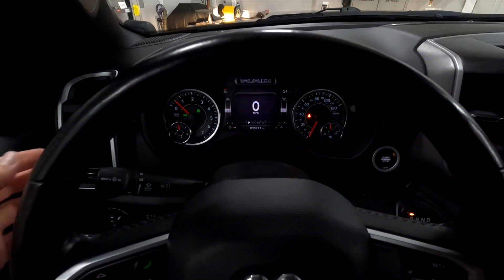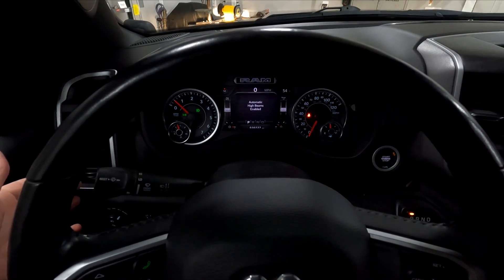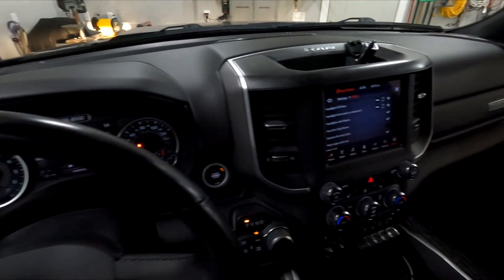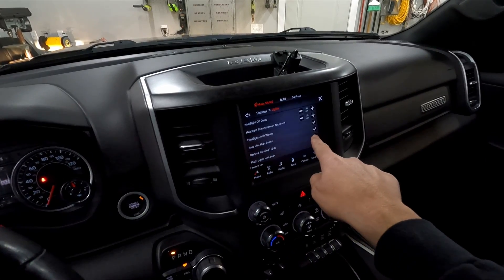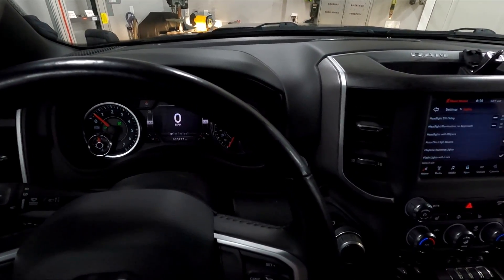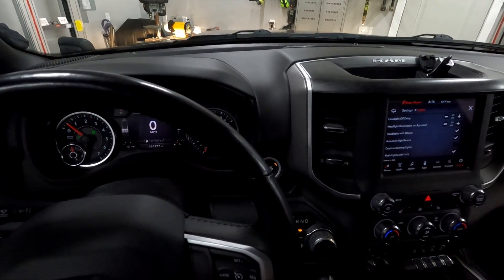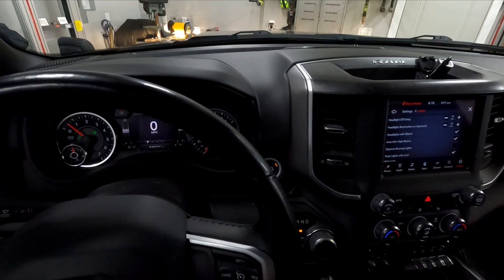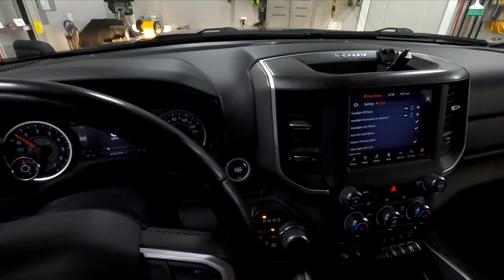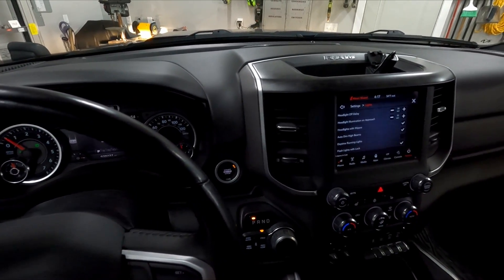It seems to have worked. The truck is running and the headlights are in Auto mode. Pulling back the stalk shows Automatic High Beams disabled and Automatic High Beams enabled options. They won't change while I'm sitting, so I'll have to take it for a drive to confirm it's working. Looking in Settings under Lights, Automatic High Beams is checked on. Everything says it should work. The whole project took 15 minutes at most and we've got automatic high beams. At the same time you can add rain sensing wipers — check out the other videos on the truck and projects in the shop. Thanks for watching.